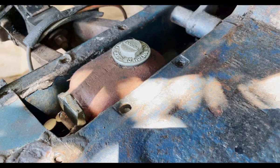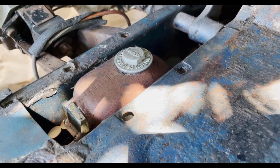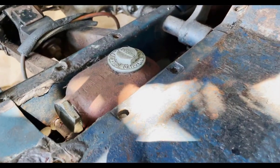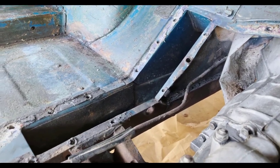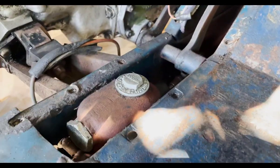Here is the brake master cylinder in a Morris Minor Traveler. They're all located the same way. In a right-hand drive car it's going to be in the chassis member underneath the right-hand side. On a left-hand drive North American car there's provision for it, but there's nothing in there. This is, of course, a British car — right-hand drive.